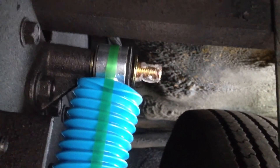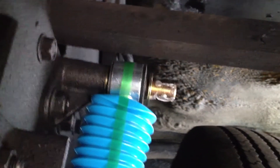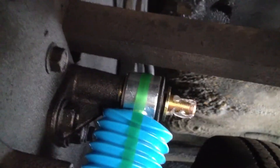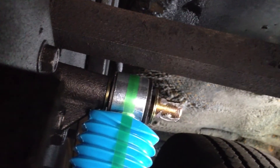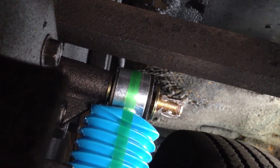On the top rear shock mount, the 6-inch grade 8 three-quarter bolt goes through from the back side of the frame rail — you've got to reach way up around under there and insert it in. There's no washer up inside the frame rail against the head of the bolt. I greased the bolt and inside the mount hole before inserting the bolt and putting the shock on it. There is a washer on each side of the shock, and I've got anti-seize on the threads ready to screw the top nut on. I'll have to hold the bolt with my 1-1/8 inch socket because the open end wrench won't fit up inside the frame rail — it's a little too long — so I'll use the socket on one side and the open end wrench on the other to hold it while I put the nut on.